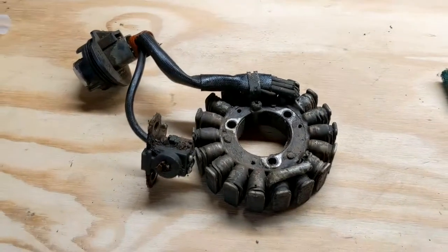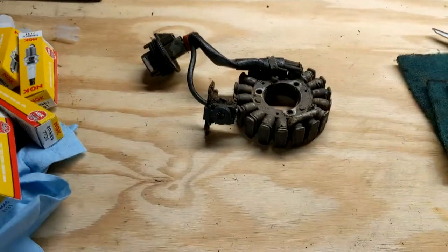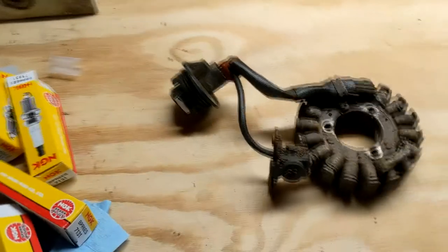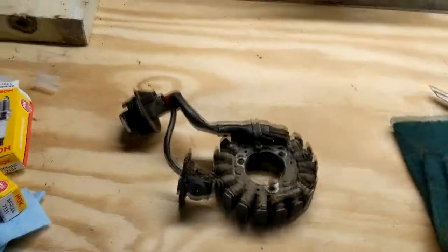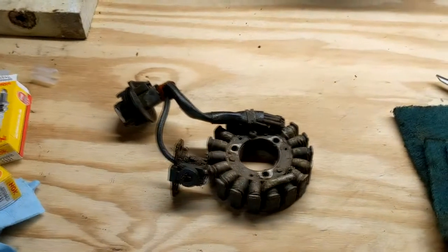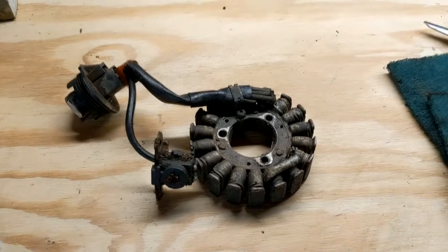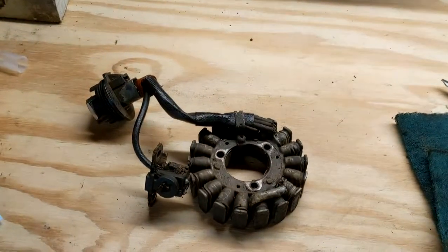Overall, it wasn't a super hard job. The biggest thing is just supporting the engine and getting that mount out — it's not that hard to do because you can just use a ratchet strap. It's not like taking an engine out of a car where you need a cherry picker. These engines are light enough that even without the ratchet strap, if you're strong enough, you can pull up on the actual exhaust and move the whole engine by hand — it's just kind of hard to do with one hand. If you guys have any questions, feel free to leave them in the comment section below. I'm also going to link a video in the description that helped me figure out where the stator even was. I've been a mechanic for a while, but I haven't worked on jet skis a ton — I've been learning everything I know on this 97 XP as I go. Hope you guys enjoyed. Don't forget to like, comment, and subscribe, and we'll see you guys in the next one.